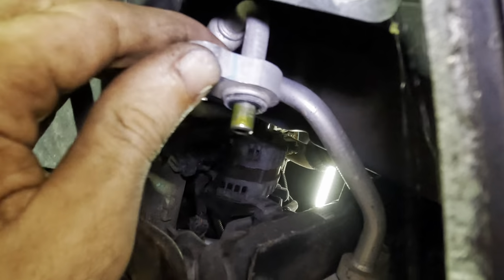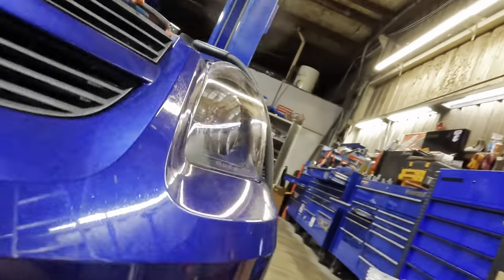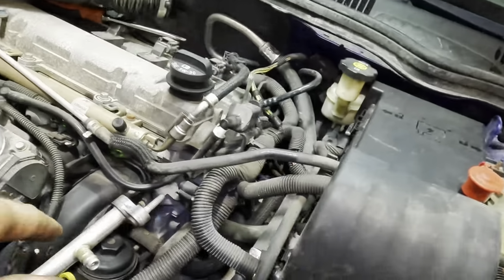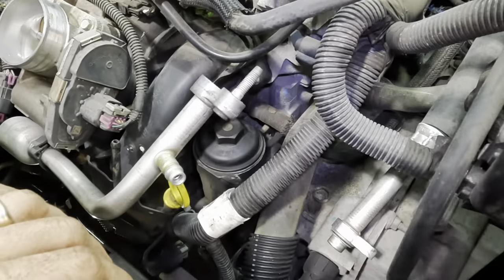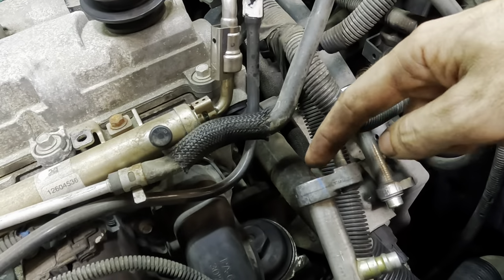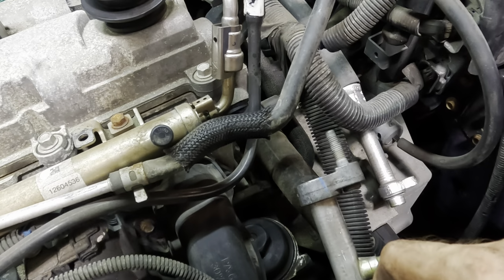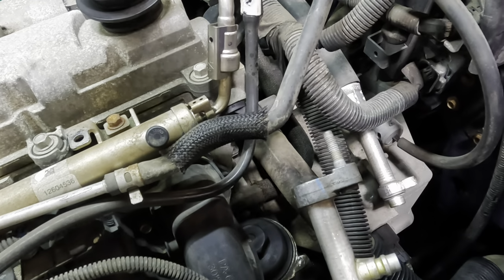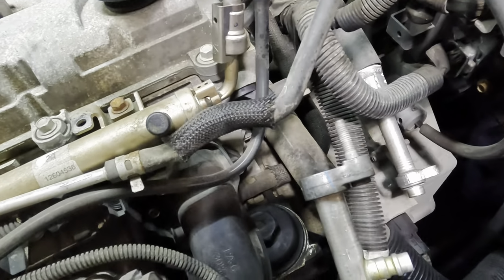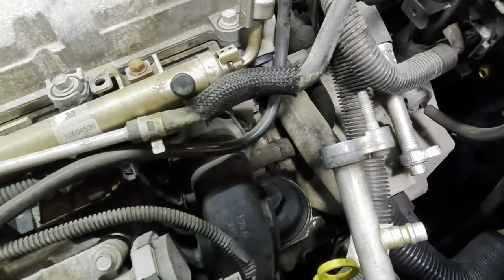All right, so all I need to do is pump some air into there. It's gonna go up into the compressor and then out through that line, and hopefully it will eject those pieces of metal of that valve. It'll shoot those things out, and then we're good to reassemble this, and fingers crossed it won't have any other leaks. All right, Troy's gonna help us out. He's gonna stand by right here and watch to confirm to me and to you whether or not that chunk of whatever comes flying out. I'm gonna go down below, apply some air pressure, and hopefully it will blow that thing out. I expect that piece of metal only made it to right around here somewhere. It couldn't have gone all the way down.